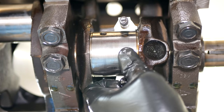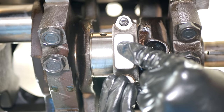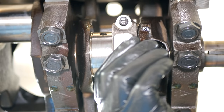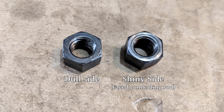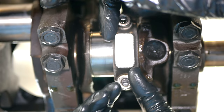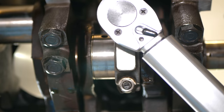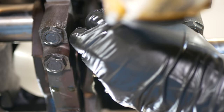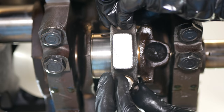Once it's all the way down and fully up against the crankshaft journal, we can remove the rod bolt protectors. Just like with the crankshaft, we're going to be checking the bearing clearance, which is why we haven't applied any assembly lube. We'll put a red Plastigage strip onto the matching cap and install it onto the rod, making sure the orientation is the same as how it came apart. A few light taps will get that fully seated and we can reinstall the rod nuts. Since these are pretty important fasteners, I like to check which is the shiny side and install that towards the rod. We'll also apply a bit of engine oil to that inner face of the nut and the rod bolt threads, then snug those down and torque them each to 48 foot-pounds, going back and forth in several steps to make sure that the cap is pulled down evenly. Once final torque is reached we'll loosen them back up and remove the cap.